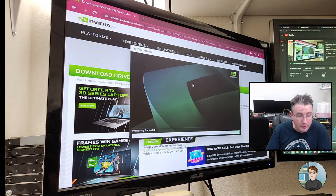Well, Smoke, it's going good. The computers are cooperating. We did a graphics card upgrade on a desktop computer along with a RAM upgrade, installing drivers, and we've got an Acer Nitro 5 laptop that was blue screening. We opened it up and reseated the two RAM sticks, and so far it hasn't blue screened. But I'm not ready to say they're both okay.